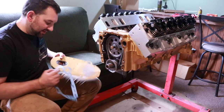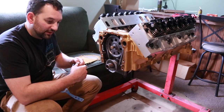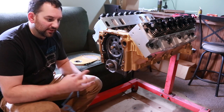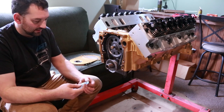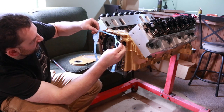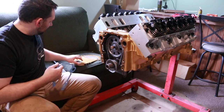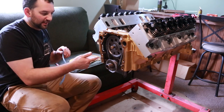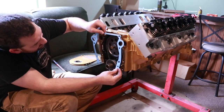I ran into that very problem, where they actually wouldn't even fit through my timing cover. So what I did was mount them in the drill and take a gasket remover type grinding pad, one that looks like a bunch of intertangled stuff, something really light for grinding, and spin it in my drill while using one of the air grinders to run the other bit with the pad on it. Then I was able to very lightly skim cut until it fit nicely inside of the timing cover, and I felt like it was small enough that I wouldn't run the risk of cracking the block putting it in, which is exactly how it worked out.